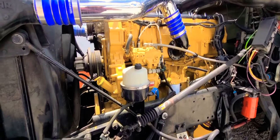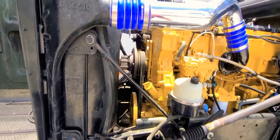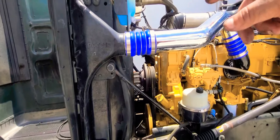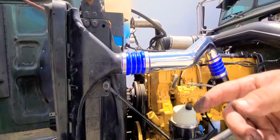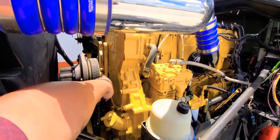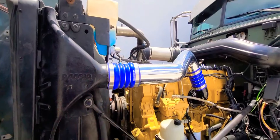I think where they're at right now they should be fine. If I do have to adjust them, I can always turn them a little more and make them a little tighter. Now that I have my fan off as well — I took off the fan from the beginning — I'm gonna go ahead and install my compressor and the belts to my compressor and the alternator. But before that, I'm gonna finish bolting down my bolts for the fan clutch so everything can be stiff without any issues, and then do the belts.